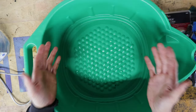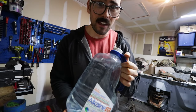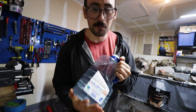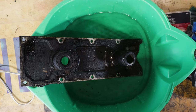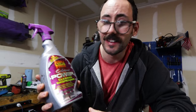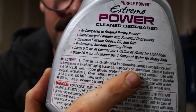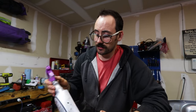So now we've got an empty bucket and a dirty part. We'll start with this part since that's where the whole thing started. Just get yourself a gallon of tap water — not alkaline, that'd be really dumb — just pour some water in there. Now I know what you're thinking: why not use something like purple power degreaser or hardcore engine cleaner? Well, if you read the fine print, most degreasers will specify you need to be very careful on aluminum. There are harsh chemicals in there that'll basically stain or etch the aluminum, or even eat through it depending on how soft it is. So those are really good for hard steel, but not good on aluminum.